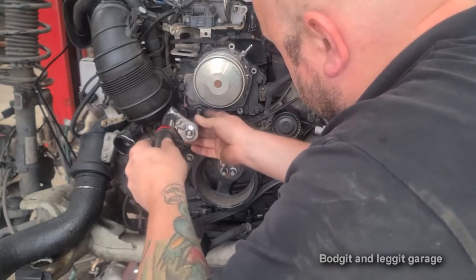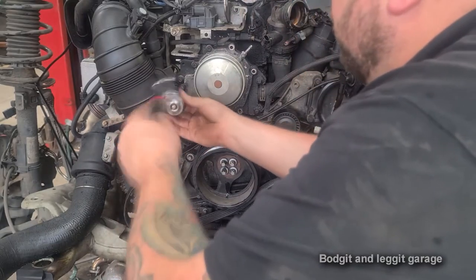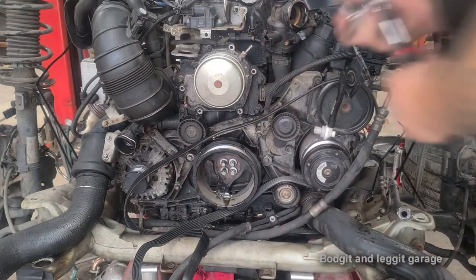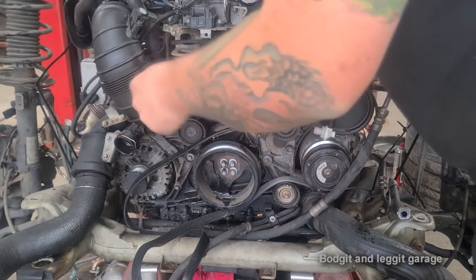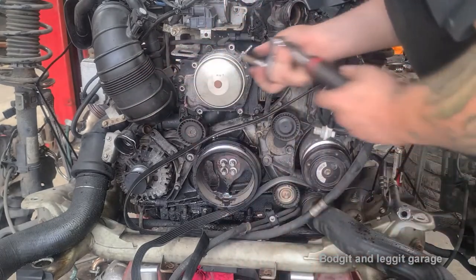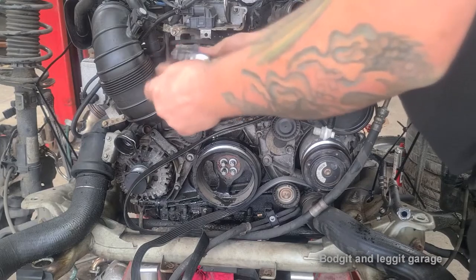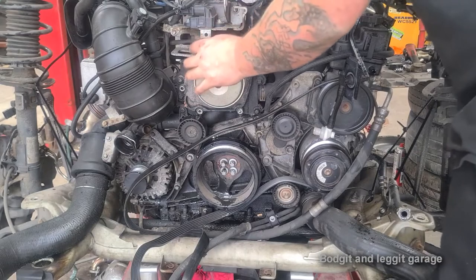It's going to leak because I didn't drain it all - I only got it out of the radiator. But obviously, because I was doing this job, you're going to be replacing all the coolant anyway. Some people do get surprised and ask why you have to replace the coolant. Well, the water pump is out. Why not just catch it? Because you'd be catching all the engine gunk and debris with it, which then blocks things up and doesn't cool your engine properly - all to try and save a few quid.